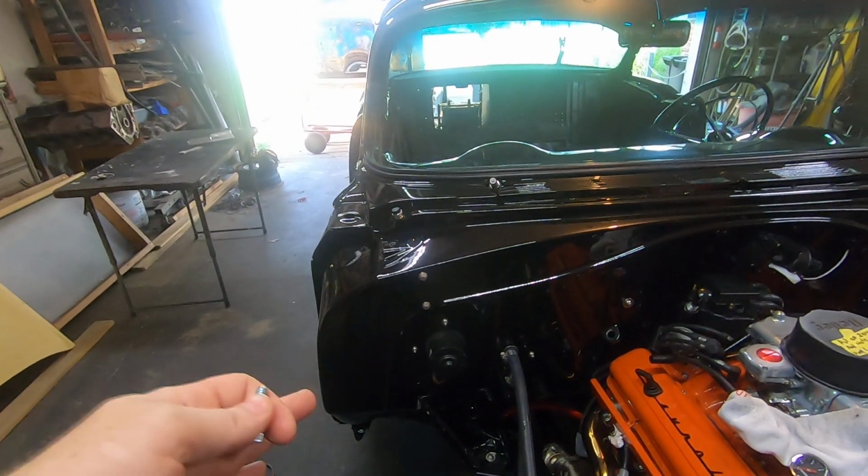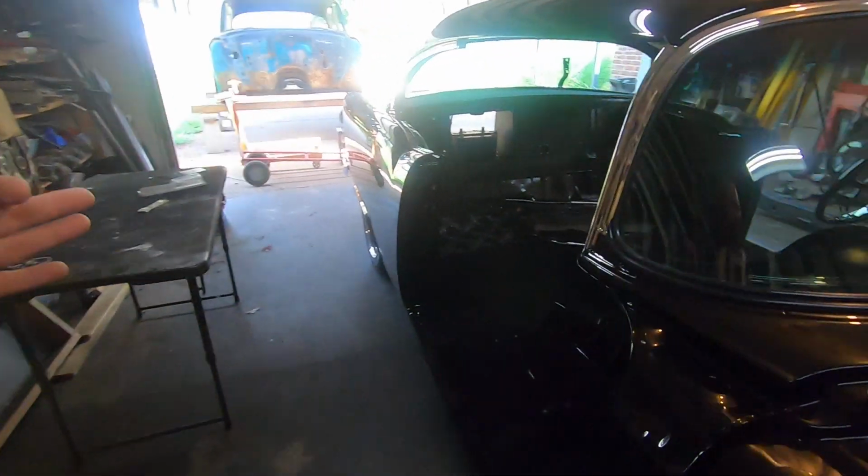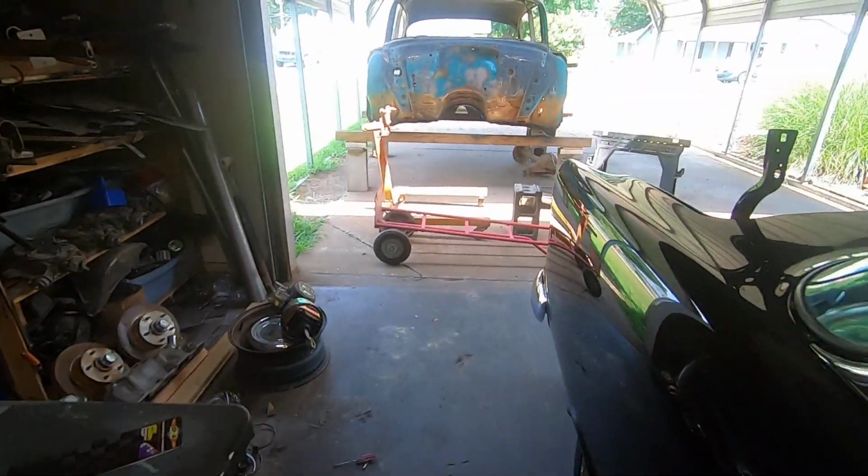So I ended up welding 1/4x20 bolts everywhere that a clip went, and that way you can lay your firewall pad up on them studs and then use acorn nuts and washers to attach it. So here's how I done it.